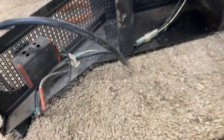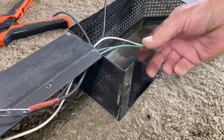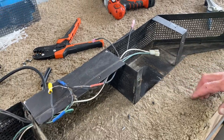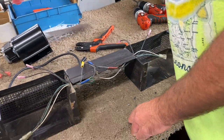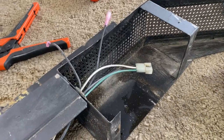A couple of other things to point out: you'll see the power cord comes in with these Molex plugs — there are actually two on each side. That's because the power cords on these units can be reversed. In some cases the power cord needs to be mounted on the left side or the right side depending on how you're looking at the stove. So it is perfectly okay for one side to have a loose Molex connector.